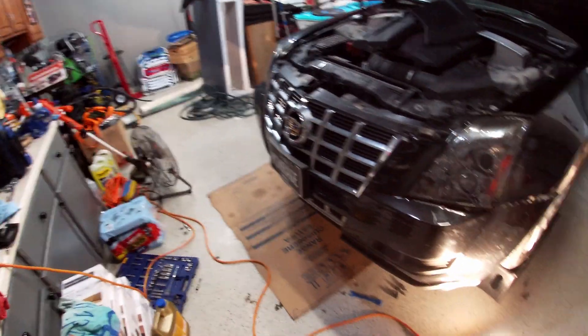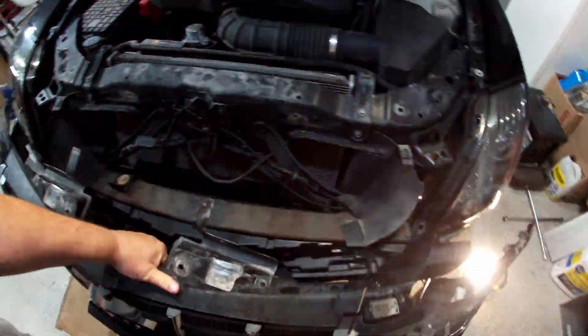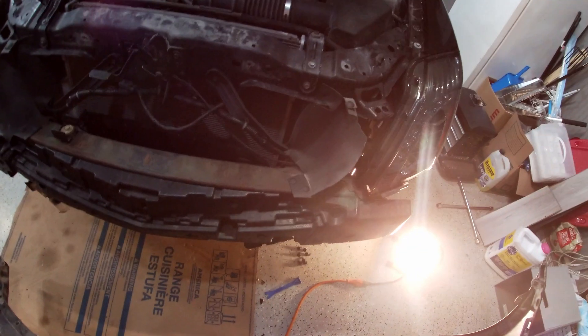Now I'm ready to pull this whole front thing off. Everything's unbolted — you can see it's loose on this side and this side — and it's literally just a matter of grabbing the assembly and moving it off just like that. Now I've got the whole bumper cover in my hands and we're going to have access to these headlights to pull those lenses out so we can get to the bulbs. I'll point out that if you have the CTS-V or maybe some other CTS models, you might have a couple extra things to disconnect underneath — like a brake cooling vent or fog lights — this one doesn't have those, so just be aware of those extra steps if applicable.